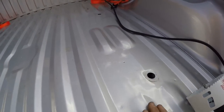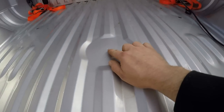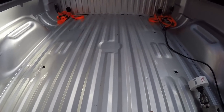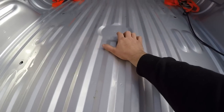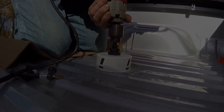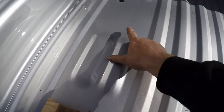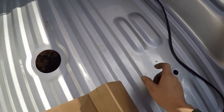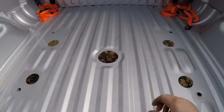Another nice thing about these 2016s — the factory drill hole locations come pre-dimpled already, which saves a lot of time over having to measure everything out and center punch them by hand. The first step is to take the four-and-a-quarter-inch hole saw and drill out the hole for the center puck. Now that the four-and-a-quarter-inch hole is done in the center, I can take the smaller three-inch hole saw and do the four outer holes. All five holes are now drilled and deburred.